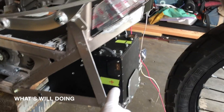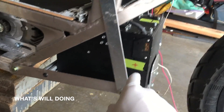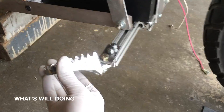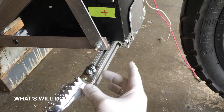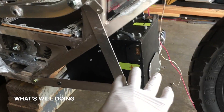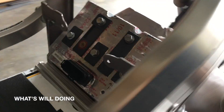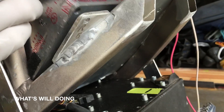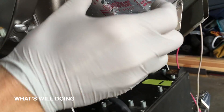I've got the mount for the battery here. There are two batteries and one's going to be mounted down here. I built this rack for it, and attached to the rack I've built my foot pegs, which have the ability to pivot like on motorcycles — so if you're going around tight turns they kick up. I need to figure out a spring system for that. So that lower battery is mounted. The controller is right here and it's going to get some good cooling because there's an aluminum plate right here touching right on the back of the controller, which also needs cooling while in use.